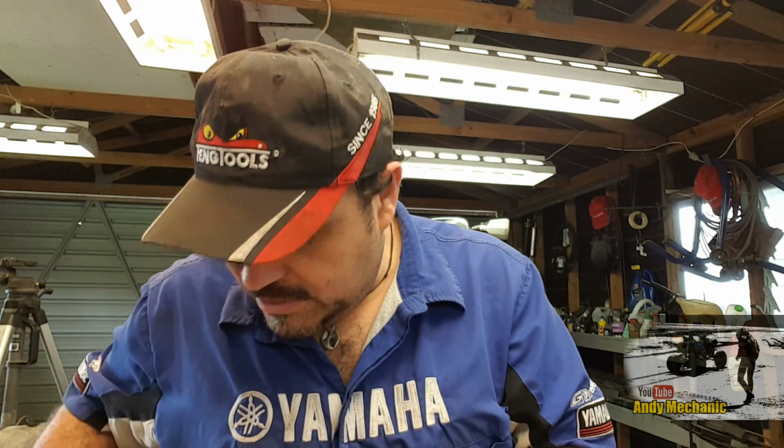What a day. Okay, so all the welding's done, and nothing caught fire. Even I didn't catch fire, which is extremely rare. Normally these Yamaha shirts tend to spontaneously combust the minute there's any sparks anywhere. But we now need to underbody seal the work that we've done. We're going to put it on the inside of the vehicle as well, just to help protect everything, give it a layer of paint so it's not going to corrode. The main reason why the floor pan rotted out is the sunroof's leaking. So this floor pan needs all the help it can get until that's fixed.